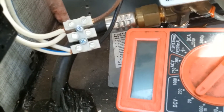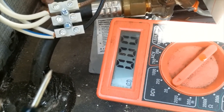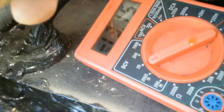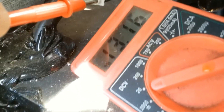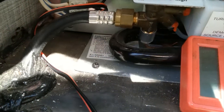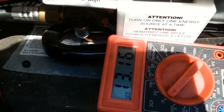The next step is to check the polarity on the plug and confirm which wire is positive and which is negative. Testing shows negative 13 volts one way, confirming the block is actually the positive. With the block reinstalled and the pigtail attached, we verify that polarity is correct and that voltage is coming out of the pigtail. The vent fan assembly is complete and just needs to be plugged in to run.